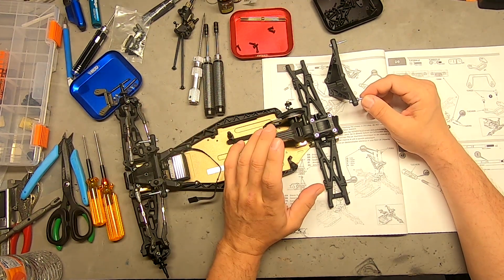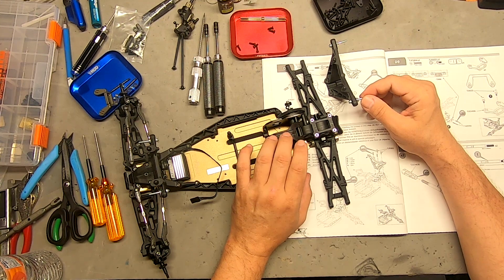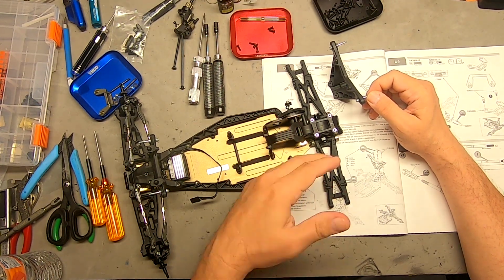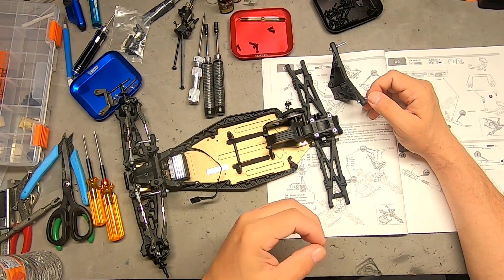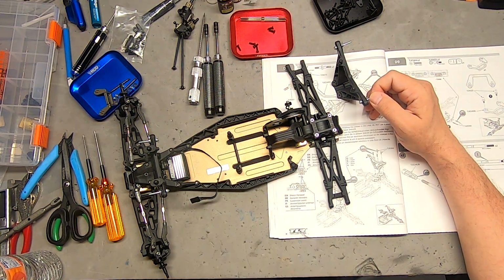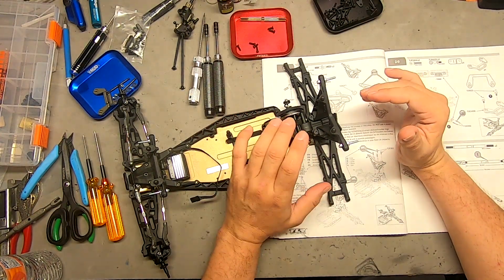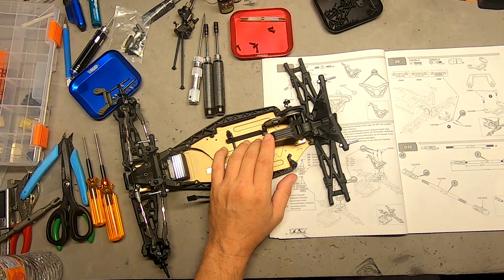For example, turn the clock back, say, 10 years ago, and for quite a while thereafter, the Losi rear yellow buggy spring, not the short course spring or the truck spring, the buggy spring specifically, was extremely popular in a lot of applications. You'd see an Associated with the TLR yellow buggy specific spring. It's sometimes not just the spring rate, it's the length of the spring. Things just have their own way of being unique. There's no other spring quite like it that made those cars perform as well. And so you'd see all these cars using that same rear spring.